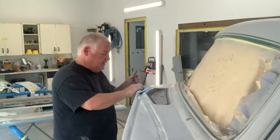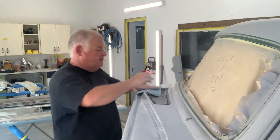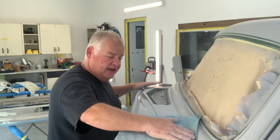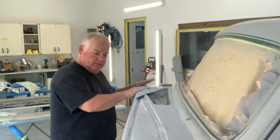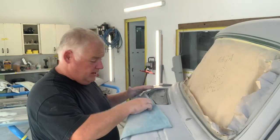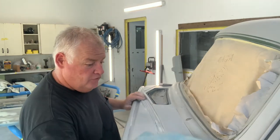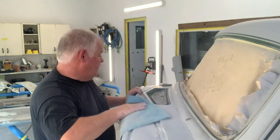If you feel a little uncertain, if you've got hard calluses or something like that, you can always put a towel in here like this - and by doing this you can feel a whole lot more. Sometimes I'll do this on the side, and at the same time when I'm wiping it down with my cleaner prior to putting paint on it, I'm also looking for anything I may have missed. If you miss something, hey, it's just going to add a few more hours - you've got to either sand it or put putty on it if it's low.